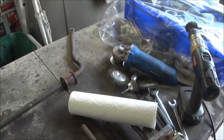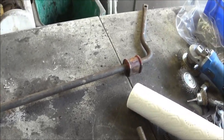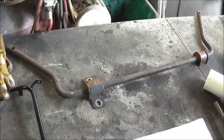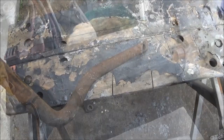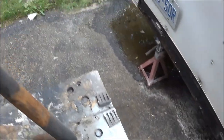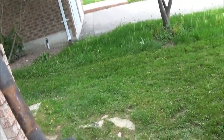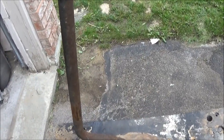I think what we'll do is finish what we've got on the table and start working on this front sway bar. A nasty looking sway bar. We're going to get that stripped down and painted. I did make a trip to the paint store this morning and picked up some new paints. Quick look at the sway bar before we get into stripping it — pretty rusty, pretty pitted. We removed the bushings, which were poly bushings. They're actually not in bad shape, so I may be able to reuse those if need be.